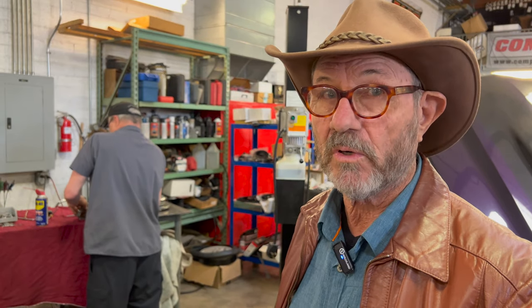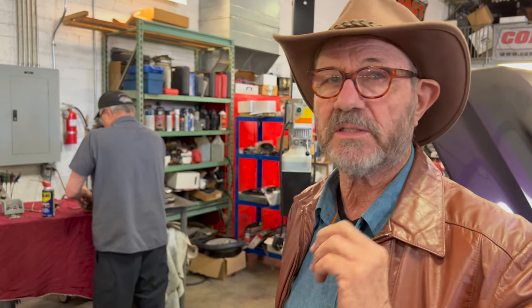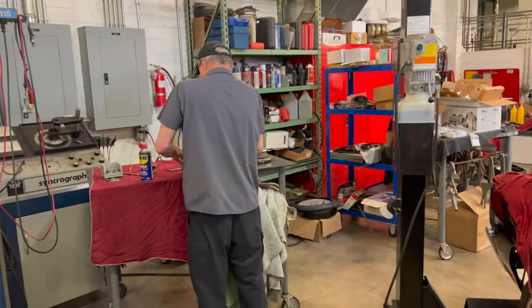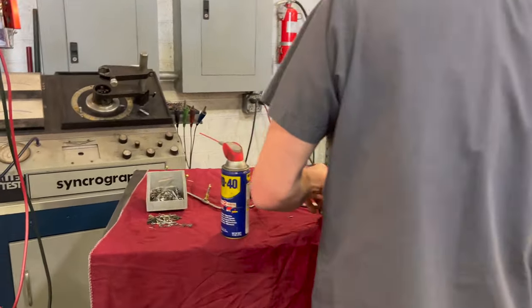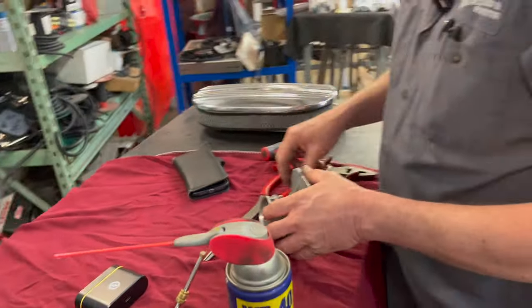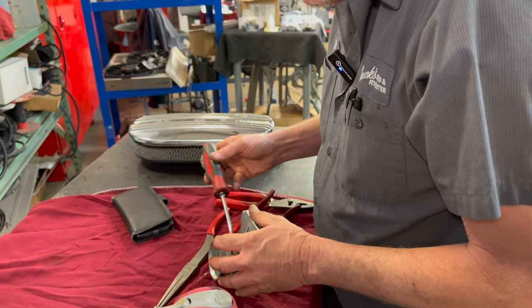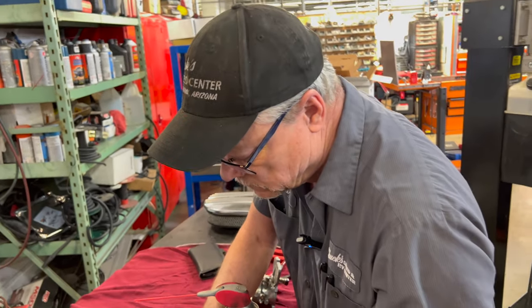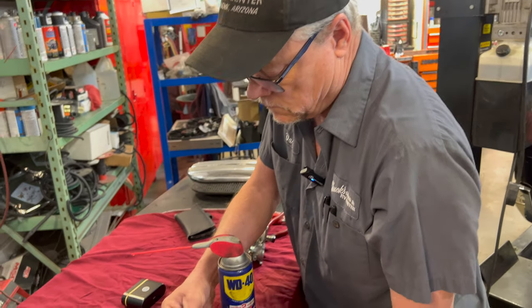You hit the gas and run, but then as soon as you got on the gas, it starved because these pumps were actually not functioning properly. So most people would have replaced the entire carburetor, and I would have fixed it, right? Yeah, except that the carburetors are a lot of money. And all that's failing is that one little part of it.